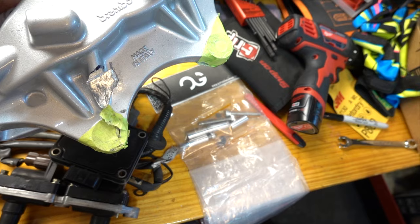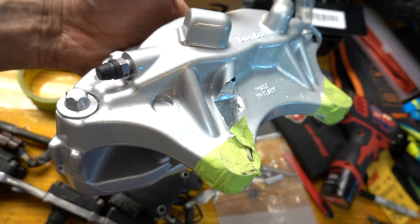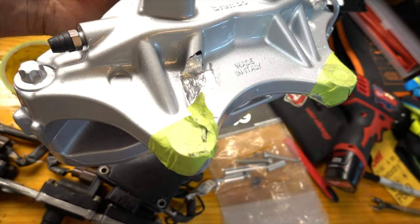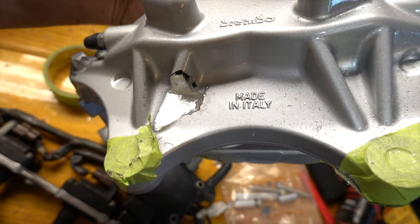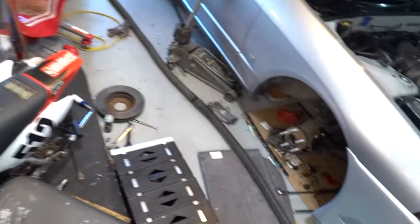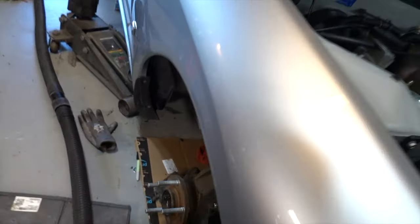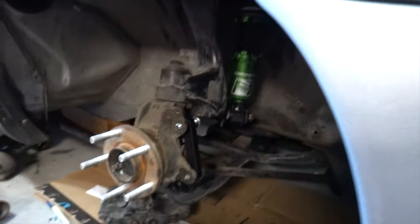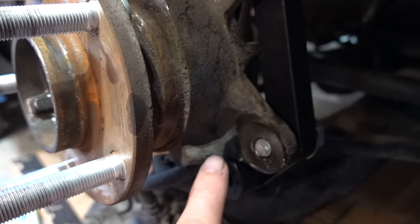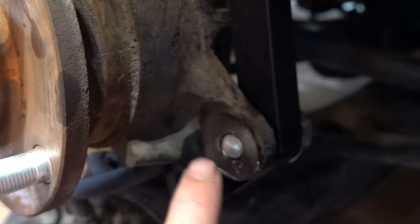It's going to get really ugly. You're going to end up with something like this — just try to grind it as cleanly as possible, which is pretty tough. You're going to grind it all the way down like that. And on the knuckle, you still got to do a little bit more grinding. This right here has to go also — you're going to have to grind this pretty much all the way down to be able to get the caliper on as well.